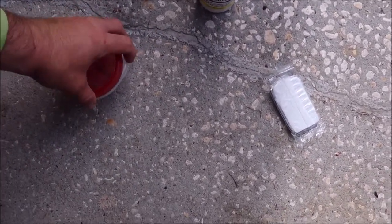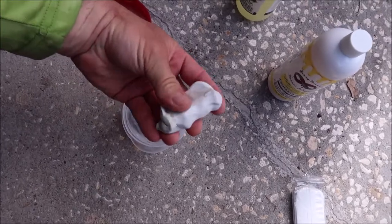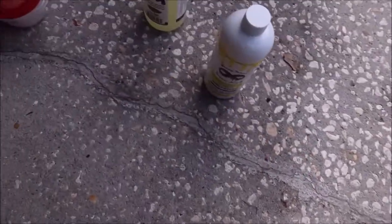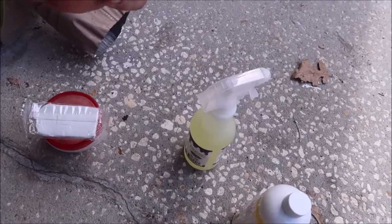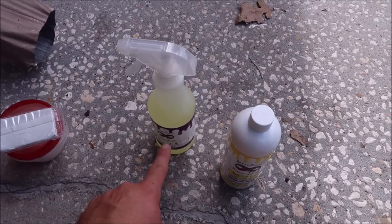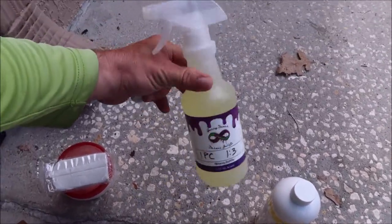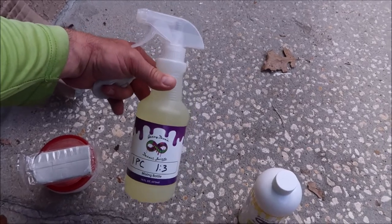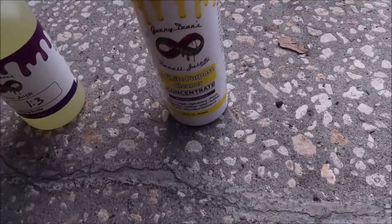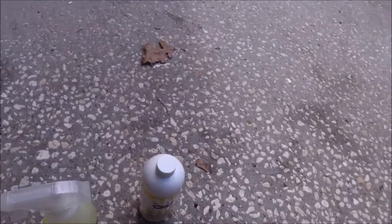I'll pull a piece — this is half of a bar, I use a half bar at a time. So what I like to do: this is diluted Infinite Purpose Cleaner — four ounces of the concentrate in this bottle, then filled up with water. These mixing bottles are available in the miscellaneous category on detailjuice.com. The Infinite Purpose Cleaner is in the Infinite lineup at detailjuice.com. So when you clay, I was actually testing several different things. This is the aftermath of a more aggressive purple clay — it actually does scuff the surface up pretty good. No big deal, I'll be polishing this car afterwards.